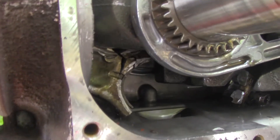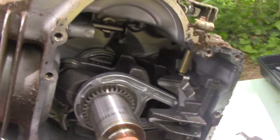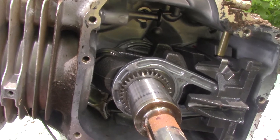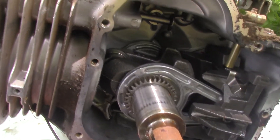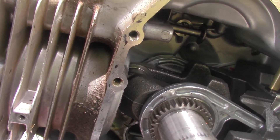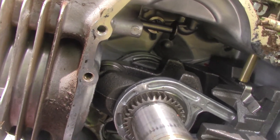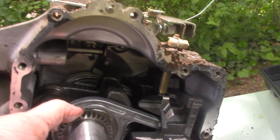Let's see what all we can see. Here's the rod — there's the rod right there. And there's where the rod is supposed to be. So yeah. Rebuildable? Who knows, man. I don't think it's rebuildable for me. I'm curious why it did all that — if the oil pump went out, got clogged, or just had a stress crack in it, maybe from when it froze up, and then it just gave out. No regrets on buying the other motor, for sure.